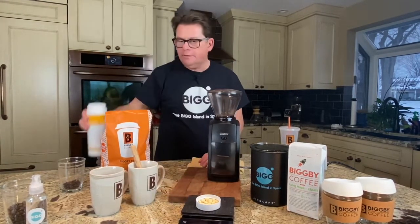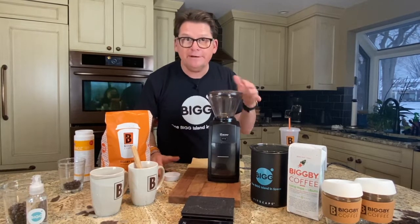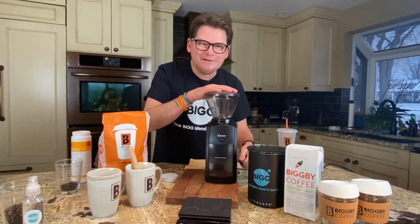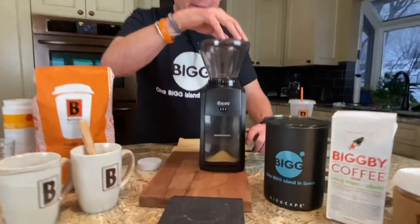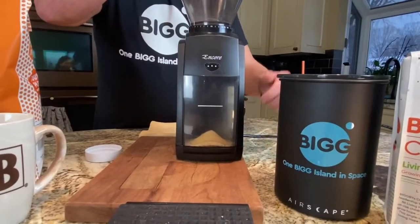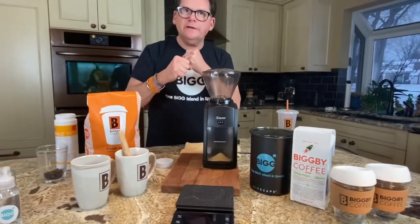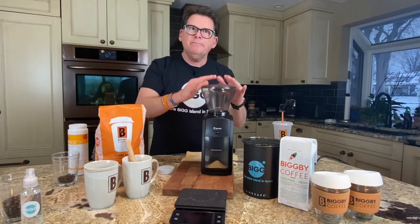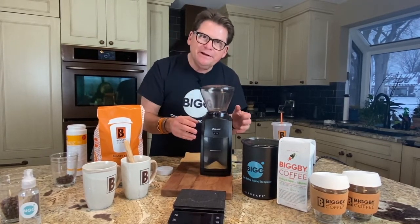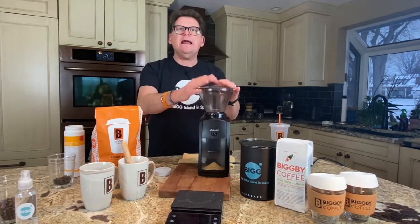I'm not going to do a full capful right now, but you just dump it in — we're not looking for an even grind here — so you can dump it in and turn it on, and let it run right through. That plant-based material will grab all the oils and remove them. I've heard of hacks like putting rice in or grape nuts, but rice puts starch in there, grape nuts leave a residue behind, and the manufacturer really doesn't recommend it — it might actually void your warranty.